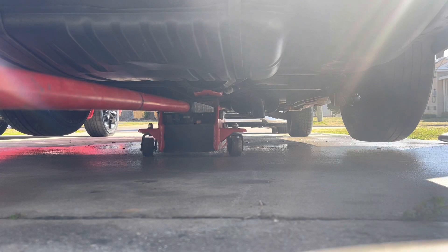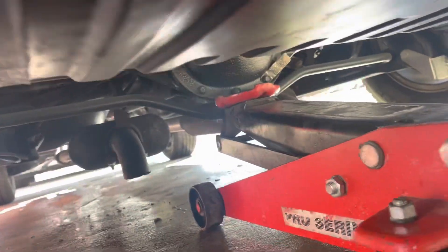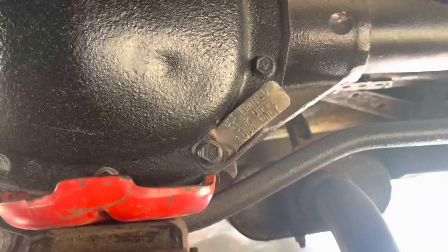I'm going to turn this wheel forward and the other wheel is going to follow — here's my paint mark again. This is how you know you have a limited slip differential: both wheels turning the same way. Hopefully this will help y'all out. If I can get under here good enough, I'll show y'all where my actual pumpkin tells you — it says 'limited slip differential lube only' right there on mine.